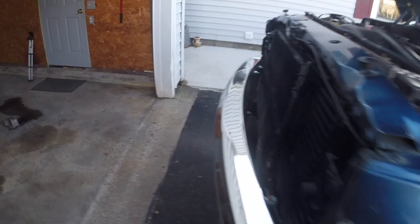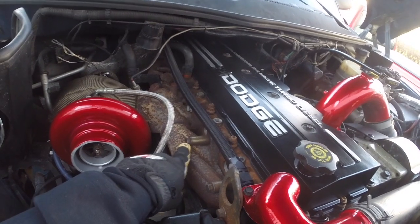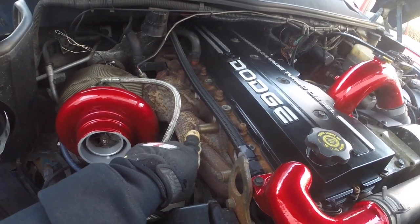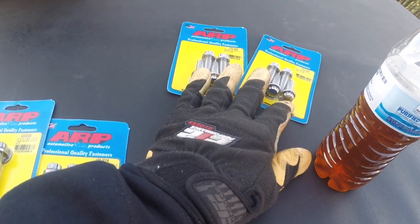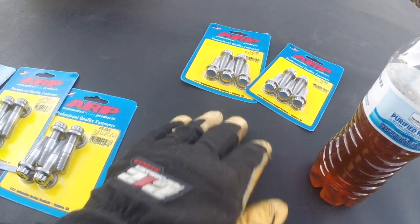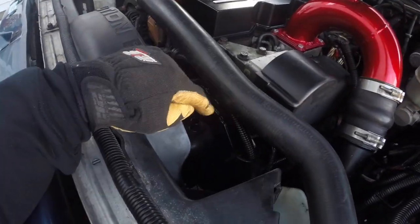I'm going to use these studs right here to hold the flange in place and get rid of the spacers — I think they're ugly. Since I'm using studs, I don't really need them. Cummins went to those because they were having problems with fasteners loosening up. I got three packages, four to a pack, so 12 total, which is exactly what I need for the manifold. I got some extra 12-point fasteners as well just to have on hand.